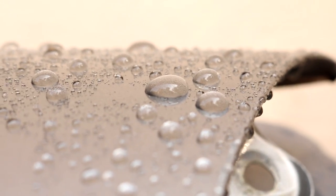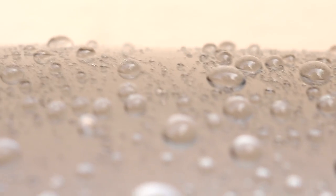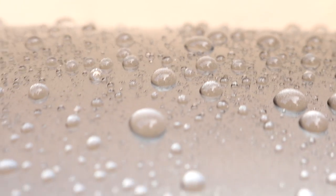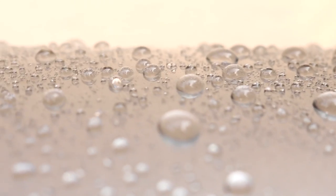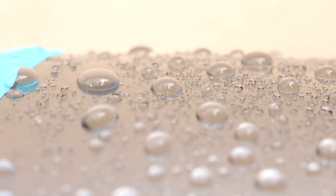The silica once laid out on your panels creates a hydrophobic barrier, and you'll notice all of the water beading characteristics that people really like. Paste waxes are really good at giving you beading, and some amino siloxanes are highly water repellent and can give you excellent beading. The polyethylene acrylics are not so great on beading and water repellency, although the acrylic they leave down does provide a good level of durability and they last out well — so they're quite good, although slightly old school.